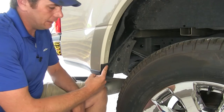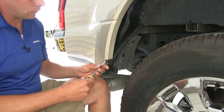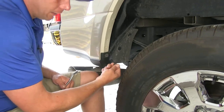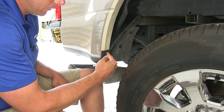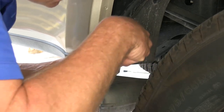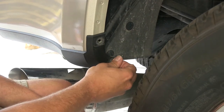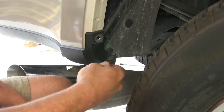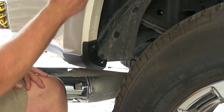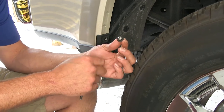For installation of the rear mud flap, we need to take out the two push fasteners — one located here and one located here. A trim panel tool is usually the best bet, but a flat blade screwdriver will also work. The top may break off — that's not a big deal since we're not going to be reusing them; just push it all the way through. We're then going to use a little bit of rubbing alcohol to clean up the surfaces. If you see any dirt or anything like that, you want to get it off. The fasteners we're replacing them with are the provided Phillips screws.